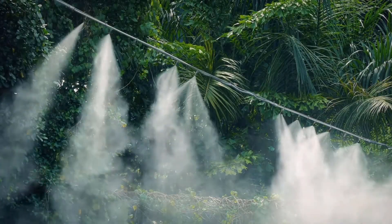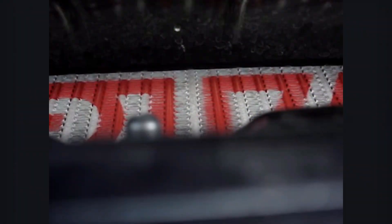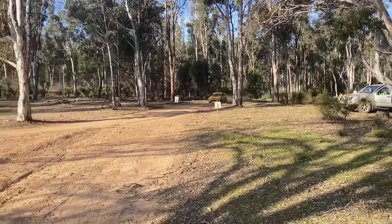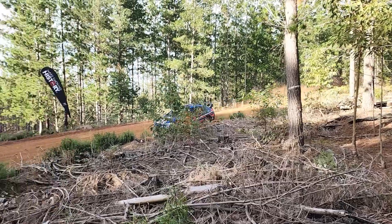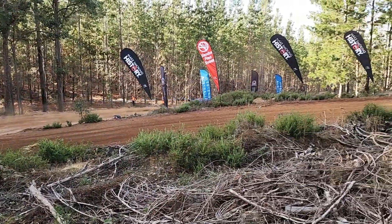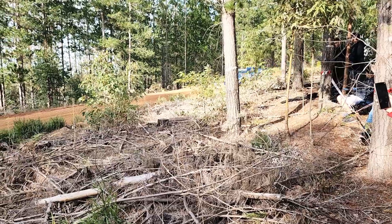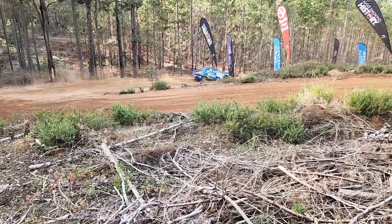The real trick is to spray a very fine mist and to do it in short bursts. If you pour a deluge of water and keep flooding the intercooler, it actually loses efficiency — and it also won't take long before you run out of water. In the earlier Subarus, there was a button mounted on the dash connected to a timer — three to five seconds of misting — and the driver made the decision when to use it. These days, when we build the intercooler water sprayers, we set them up automatically controlled by the ECU, depending on engine RPM, boost pressure, and air temperature. The intercooler water sprayers will be triggered if and when needed, which means one less thing for the driver to worry about, the water can be used more efficiently, and the results are more consistent.